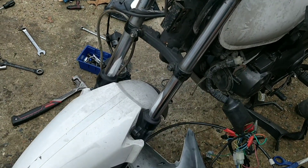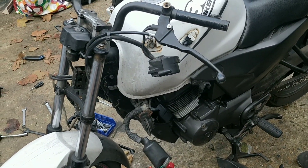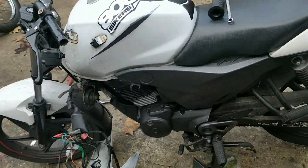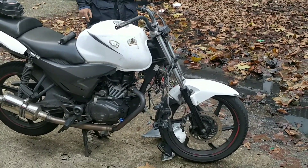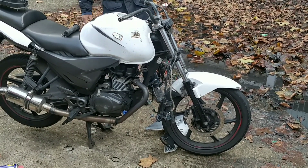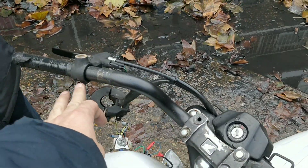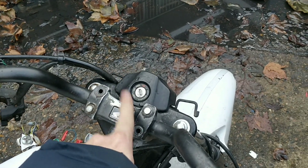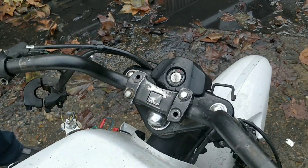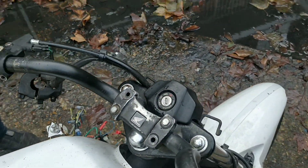Rabjab did none of the work. Look guys, look at the bike so far. Look at the front of the bike — you can see it already. It's a different bike. So much better with the straight bars and the light on. It's going to look 100 times better. Some of the lessons you're learning here: don't undo these nuts first because you'll need some perches to get some of these off. Take them out at the end. When you put the new ones on, put all the side things on first, then nip down the middle ones by hand, line everything up and then nip it all down. We're probably going to have to drill locating lugs.